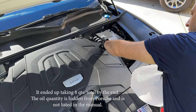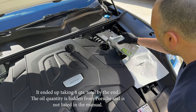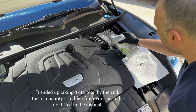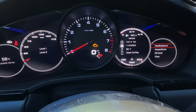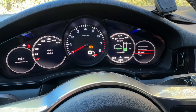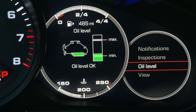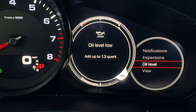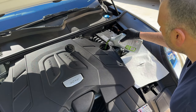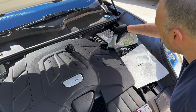I started by adding six quarts of oil, since I knew it would take seven but wasn't sure how much actually drained and didn't want to overfill. I started the engine with a little more than six quarts and then checked the oil level electronically. To do this, run the engine for a few minutes, turn the car off on level ground, then turn the ignition back on without starting the engine and let it sit for up to two minutes — it will register the level. It said to add up to 1.3 quarts, so I carefully added one quart, since it's always easier to add more than to remove oil.